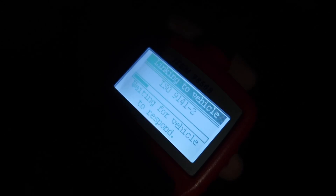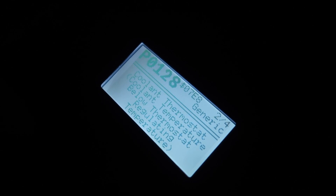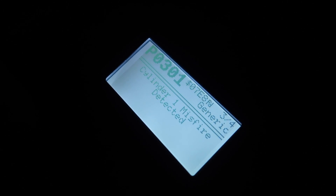Waiting for vehicle to respond. So there's a cylinder misfire. Is that it? Cooling thermostat temperature, low thermostat regulation. We went inside, we cleaned the MAF sensor and we cleaned out the throttle body to see if that would help the car a little bit. Towards the end, my little cousin came over with an OBD scanner. He plugged it into the car and we found out this thing has a misfire - it's misfiring in cylinder one.